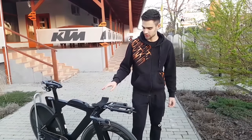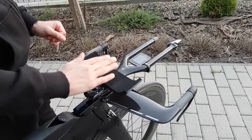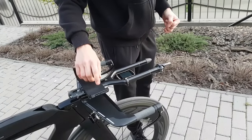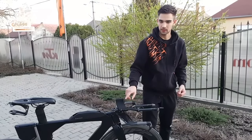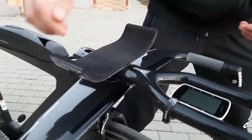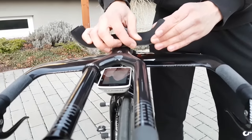So you can actually stay on your base bar when braking hard and that can save you a few seconds when cornering. I'm going to touch on the time trial position a bit. With the stock bar pad that the Speed Concept has, the cups are plastic and the foam isn't too grippy, which creates a problem — when I go over a rough surface I automatically slide forward and that renders me unable to put the power down. So I found this product on Instagram by a small company called Watchop. They make a custom carbon fiber armrest plate which saves about 200 grams. But the most important feature is that it's very deep — from the front you can see it comes up very high, so you get a very secure fit and you're not going to slide to the outside. The foam included is also quite tacky, so you're not sliding forward either.